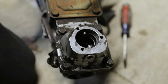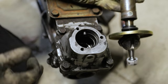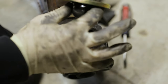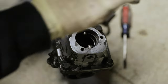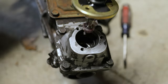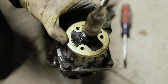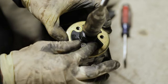At this point you're ready to drop your shifter back in. If you've got an NA it's only going to go in one way. If you have an NB, look for the white dot — the white dot faces forward. Take a little bit of grease and lubricate the bottom of the shifter before dropping it in. Line up the grooves, drop the shifter in, then replace the 10-millimeter bolts and just snug them up — you don't need to go crazy on these at all.